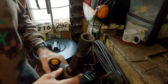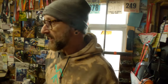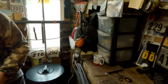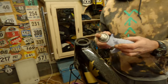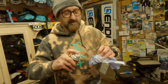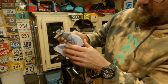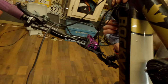Take the bottom bearing off the forks and put it in the tray. Now we want to clean everything up — this is where we need our disc brake cleaner. First we're going to do the headset cups. I use the Fenwick stuff — absolutely awesome products. Just literally go around it and clean all that crud out, then use the dry end to get it nice and dry. Repeat the process with the bottom cup — exactly the same.